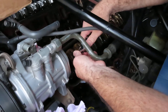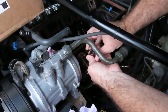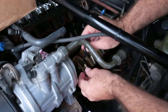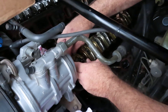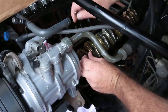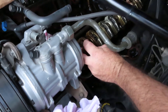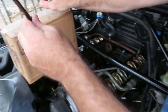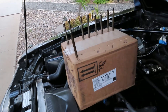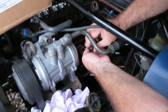I've already cracked all the bolts so they're pretty much loose — I should be able to get them off with my fingers. I don't want to remove each rocker arm; I want to keep them intact so I can keep track of them, and when I take the heads to have them rebuilt, I want that guy to inspect them and make sure I don't need to replace them as well. I went ahead and made this box to replicate the engine layout so I can keep track of the push rods and make sure they go back where they came out from.